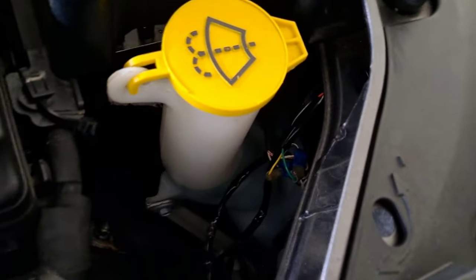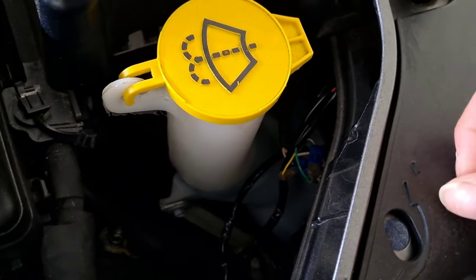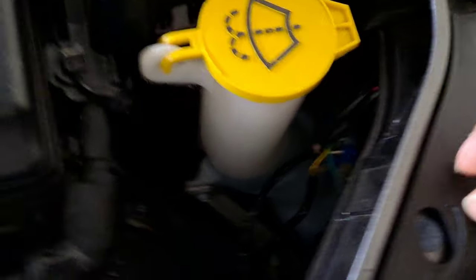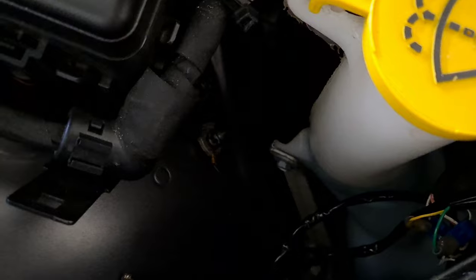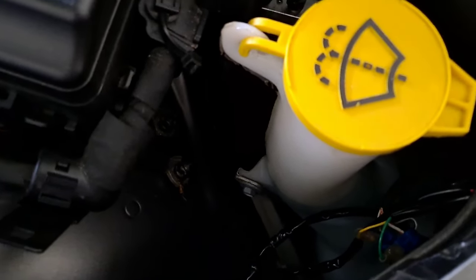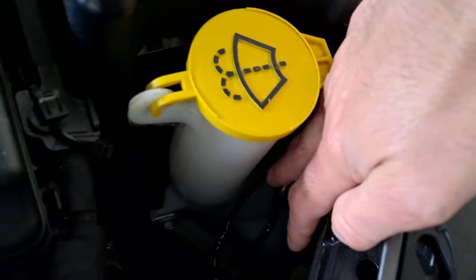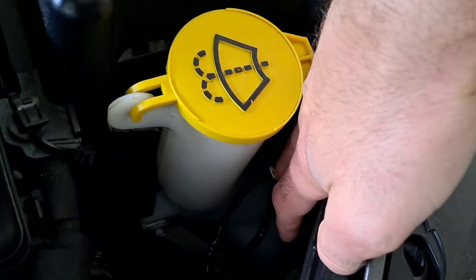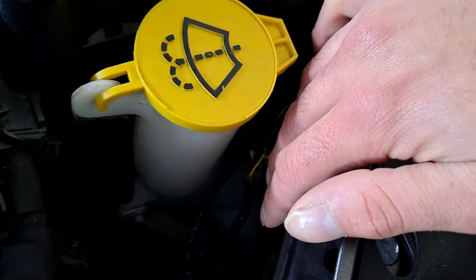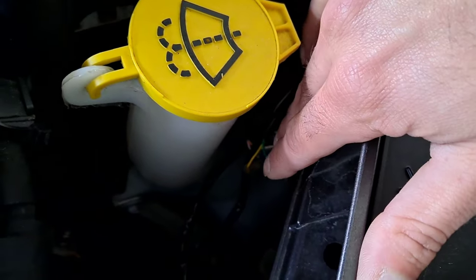Basically, the lights come with four wires. It's going to come with two little black hoses, as you see there. One hose is going to have a red and black wire — obviously the red is power, black is ground. And as you see, the ground is right there. I grounded it there, and the same on the other side. So that's one wire gone. Then you're going to have a green and yellow wire. The green is for the DRL, and yellow is for the turn signal. The yellow connects to pin number five, and the green is pin number four — DRL.